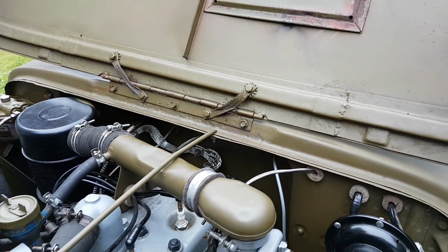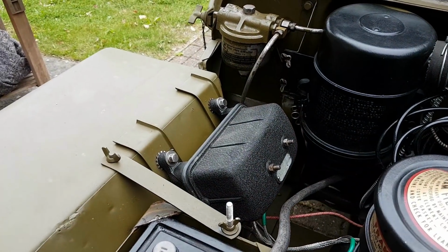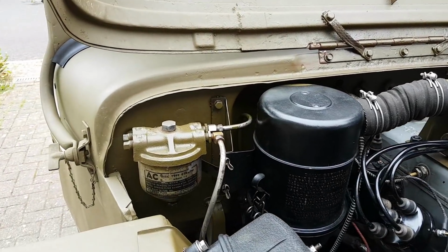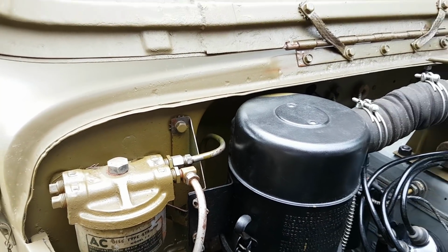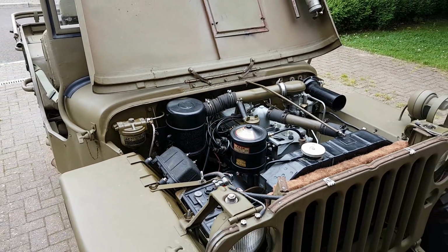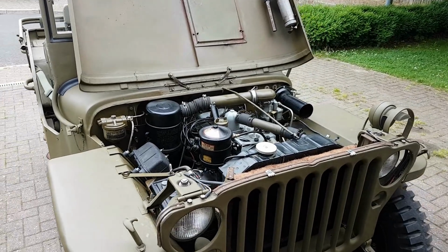You can see it on the bond straps there, on the regulator, things like that. They were really important for grounding. So they do have a purpose. They're not just there for looks. They stop things rattling apart, and they also cut into the metal, and they're used for grounding, and they make quite a difference to how the Jeep looks. And even though they're just a small detail and not very expensive, I think they make a big difference. So that's quite a straightforward one to do there.